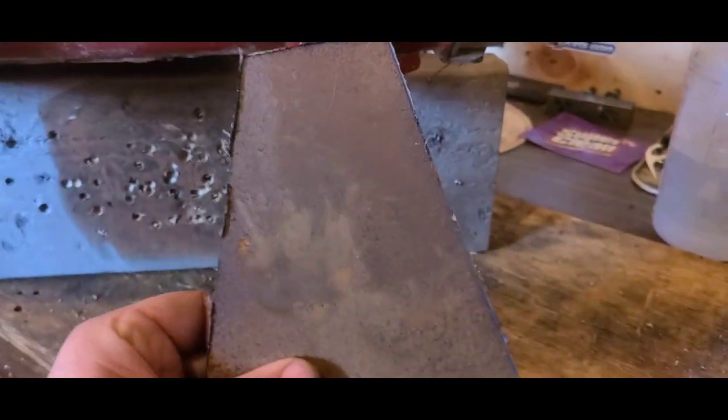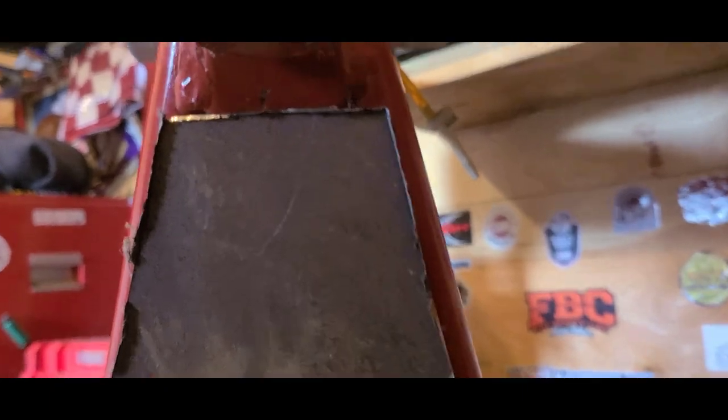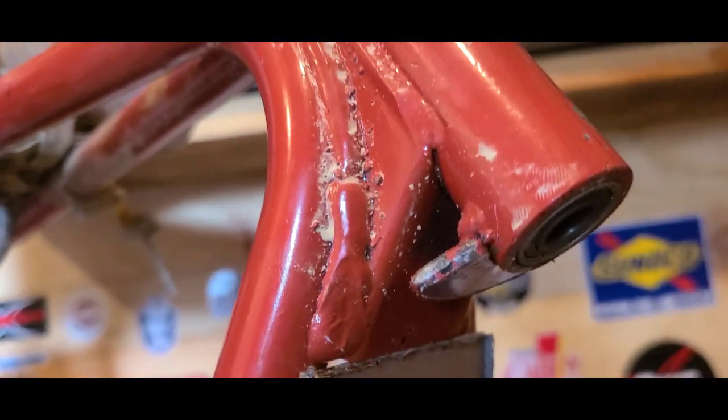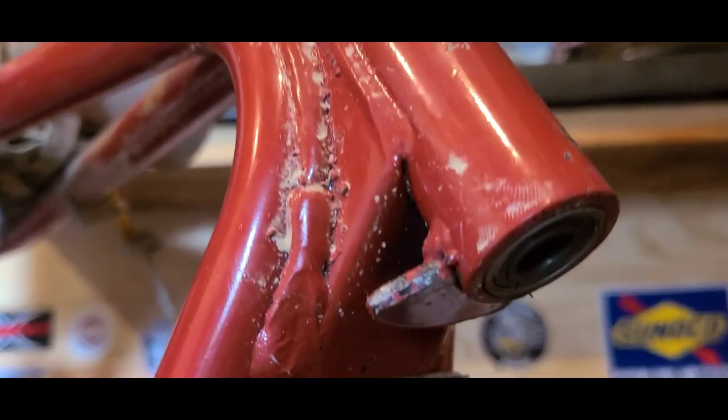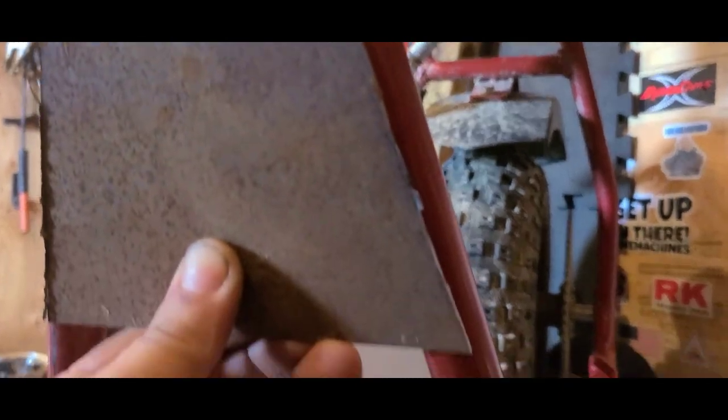This — you're going to be careful because I haven't cleaned it up yet — is going to fit right underneath that front neck support. I'm just making these terms up guys, but you know what I'm talking about. We're going to go flush up to the bottom, and I'm going to tack weld it onto the frame on both sides. Clean this up and get after it.